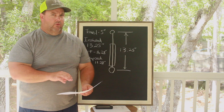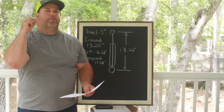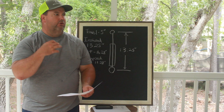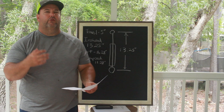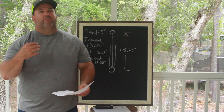One of the very first things I'm going to want to know from you is what vendor made your coilover shocks and springs, and what part number shock are you running from that vendor? That information is very important to me because I can go to that website, look that shock up, see if it's double adjustable or single adjustable, see how the clicks are set up, and they may even have information on how the valving works and how much pressure is at each click.